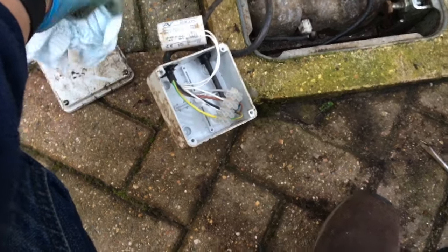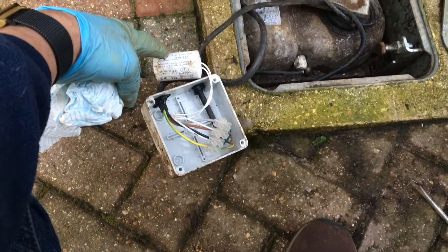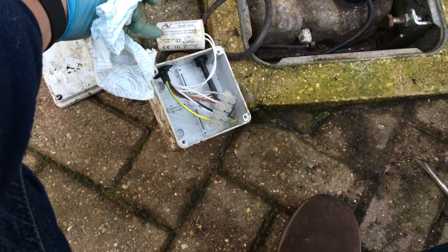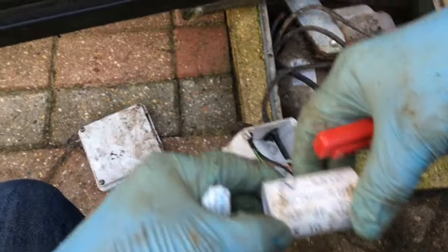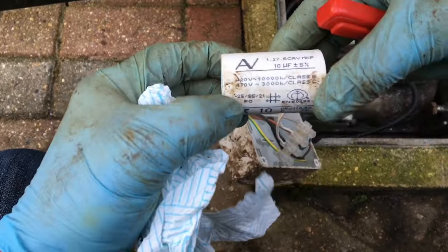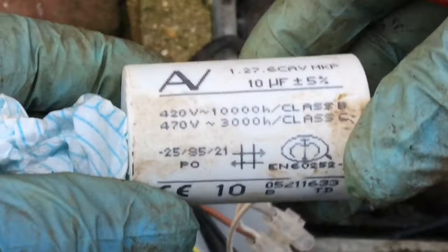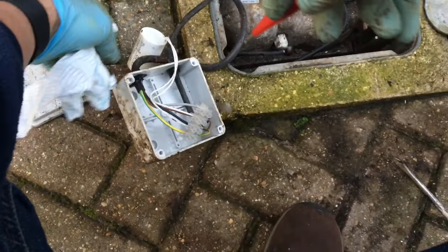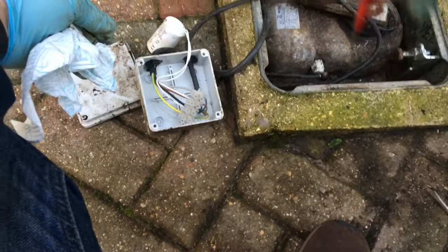I know it's the capacitor because I replaced it with another capacitor from my spares box, which is actually 12 microfarads, but again high voltage — very important that it is a high-voltage mains-type capacitor. You can see on there it says 420 or 470 volt depending on the classification spec. We replaced it with a 12 microfarad capacitor and lo and behold the motor then jumped into life, whereas previously there was no sound or anything coming out of the motor.